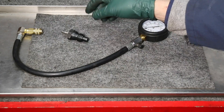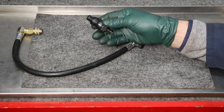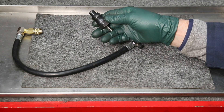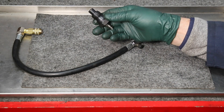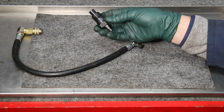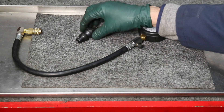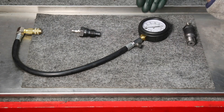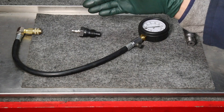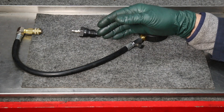The problem is this will not work in the newer OM602 and 603 engines from about 1990 up to 1994. So this has always been a problem for some of our customers. They say, hey Kent, how am I going to do a compression test? I can't find an adapter that goes from a diesel compression tester into these later OM602 and 603 engines.